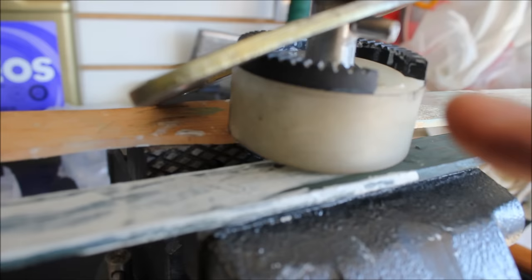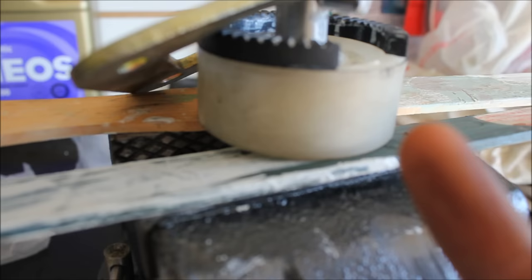I got this new cup from Concept Z because from the dealership I would have had to purchase a whole shifter assembly just to order this plastic piece. This plastic piece is only about $30 so I just bought it online. If you're wondering how to get the shifter into the cup, I use lithium grease. I don't want to use any petroleum-based grease on this particular product because some plastics react poorly to petroleum-based greases, so I use lithium in this case.